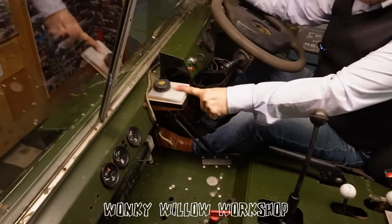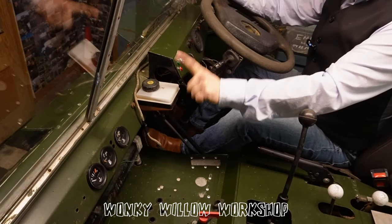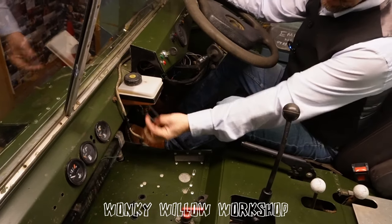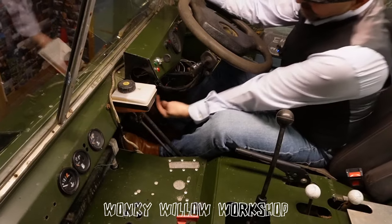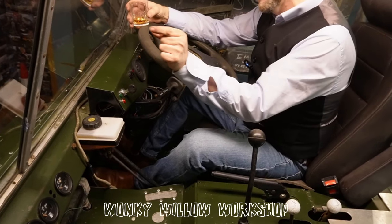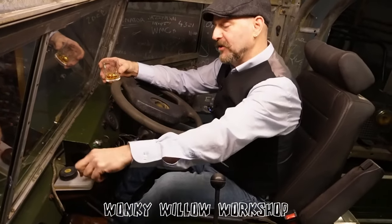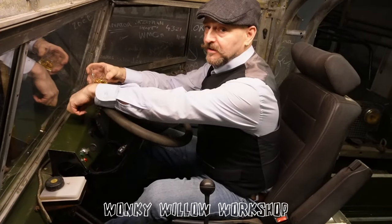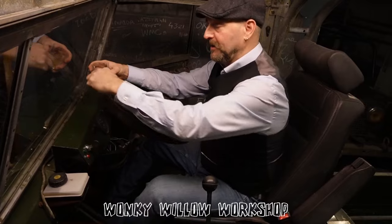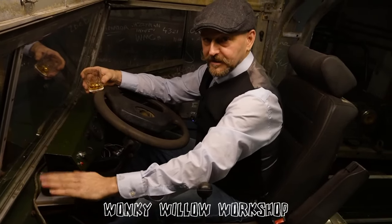Because there's no bonnet space, this is the problem with forward controls. So that's the reservoir. Top tip, Freelanders are superb. Freelander comes with little remotes, so you can take the little reservoir. The master cylinder that's in here, they've got little adapters with pipes on it. So rather than the reservoir sitting on the top of the master cylinder, you take out the master cylinder, take out the reservoir, throw that away, the little Freelander things fit in the top, and then your pipes come over. Oh, perfect.